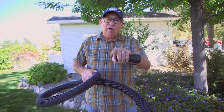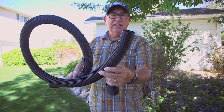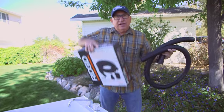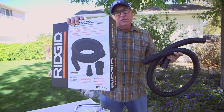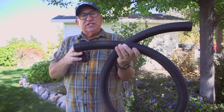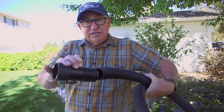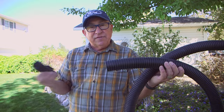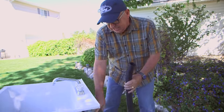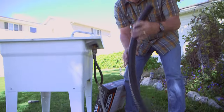A better approach to get it to drain dependably every time is to use a rigid hose like this one. You may recognize this — it's vacuum hose that comes in a kit. At the time of this filming, it's around seventeen or eighteen dollars for a length of this hose. The nice thing about this hose is it's not going to collapse. When you buy it, it comes with ends on both sides; we just took a utility knife and cut those off, ending up with this piece of hose. We're going to replace the limp discharge hose with this rigid hose.